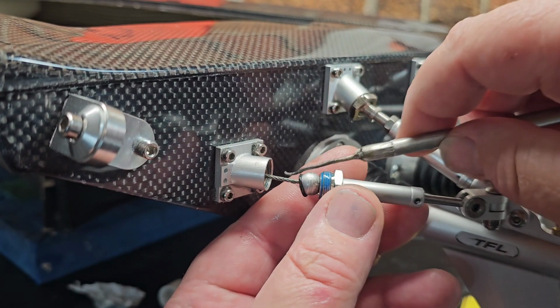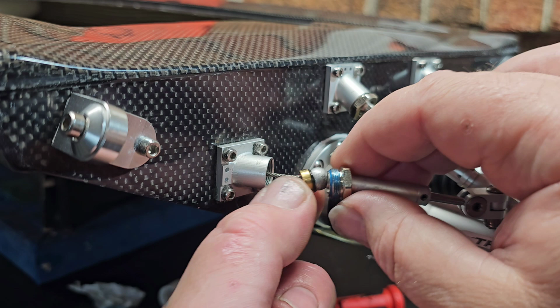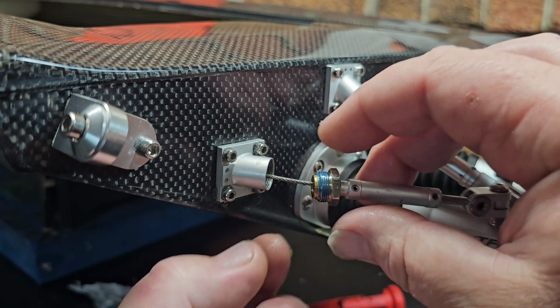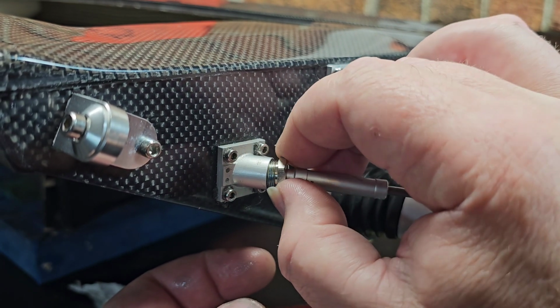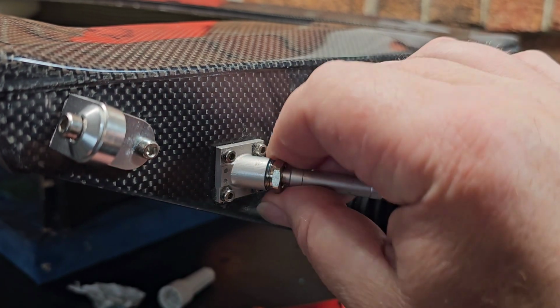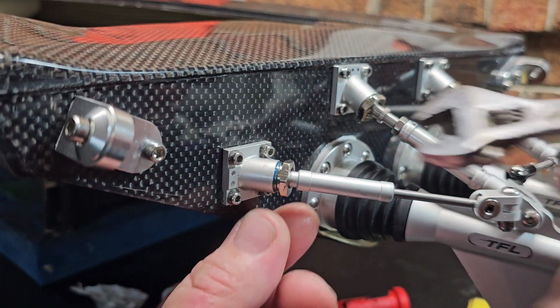When you put this back together, go ahead and situate everything in the nut. So push the nut up over the ball and have that little O-ring in place. Then you put the cup on there, and then you basically slide that into the base. That's going to be the best way to do it. If you try putting the nut on with the cup in there, kind of wobbling around, you're going to strip your threads out, wear something out prematurely. So going to put that on, make sure it's not cross-threaded.